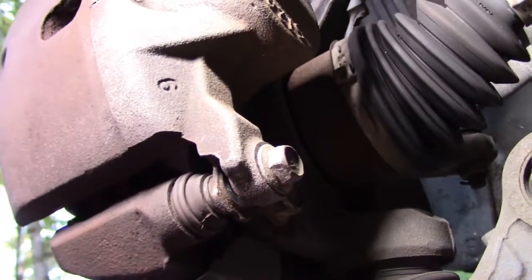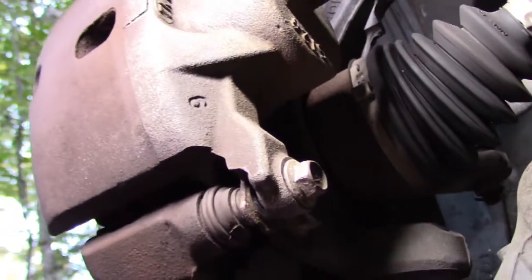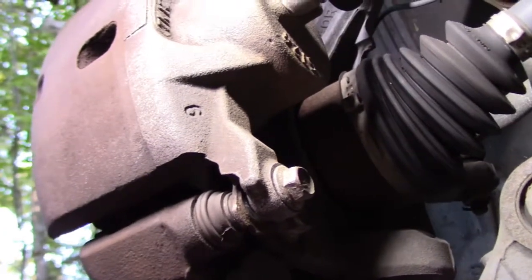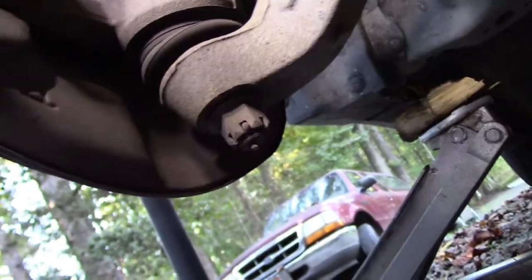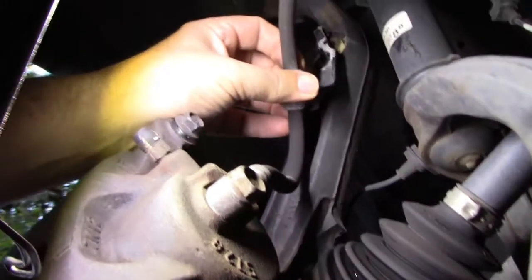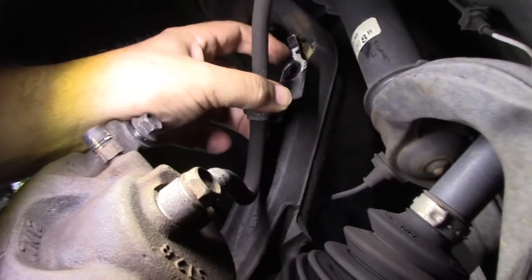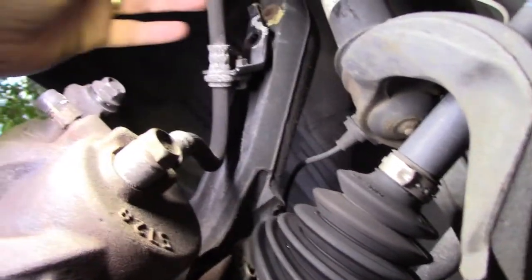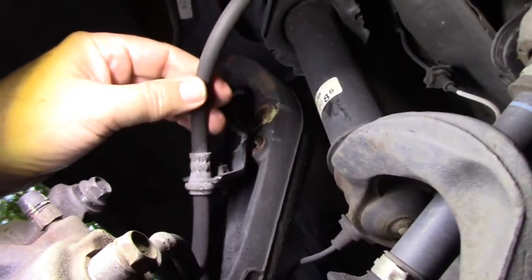I also found a small hole in the boot for the actual pins - that was a bit of a surprise. Down here you can see the bolt that holds the bracket on, and there's another one up top - those are like 17 millimeter. And up here there's a bolt for the brake line - that's a 12 millimeter also. When you start removing all this, you may need to suspend the brake line with a wire or bungee cord so you don't put a lot of tension on it.